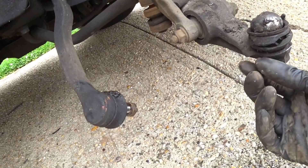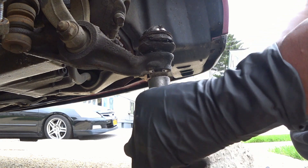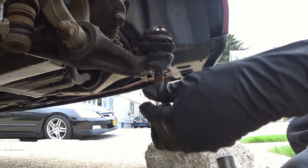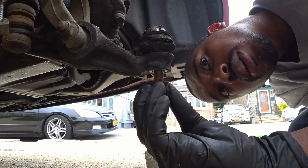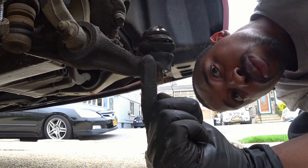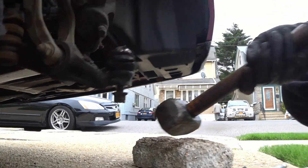Next, I'm going to try to take the cotter pin out of this one, so I'm going to take off this bolt at the bottom. We got the screw off. Now here comes the hard part — we have to hope that when we hit it with the hammer it will just pop up. Because if I hit this stud right here, it will mushroom — it will flatten out and I won't be able to get it out of the control arm. So not with a hammer especially.